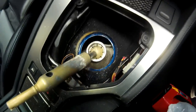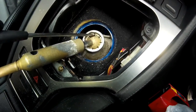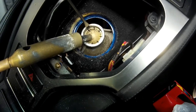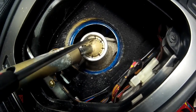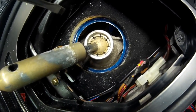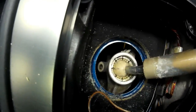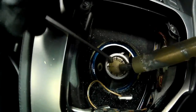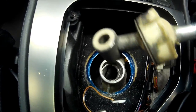Now we're back in the car. To remove the shift lever and nylon bushing, use a screwdriver and turn the nylon bushing approximately a quarter of a turn clockwise. There's a slight indent on the alloy frame, and on the plastic bushing there's a corresponding part which locks into the alloy frame via a quarter turn. There's a little plastic tab on the bushing - push your screwdriver against that and push it around the quarter turn needed, then it will lift out like so, removing the entire unit from the car.